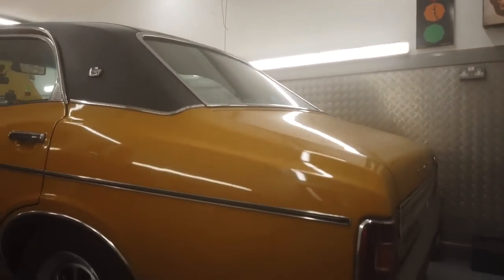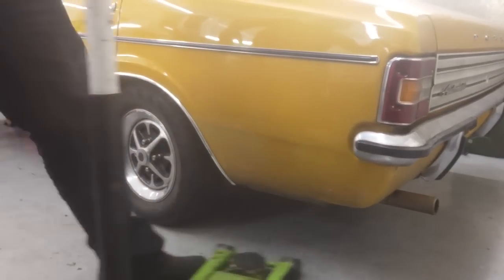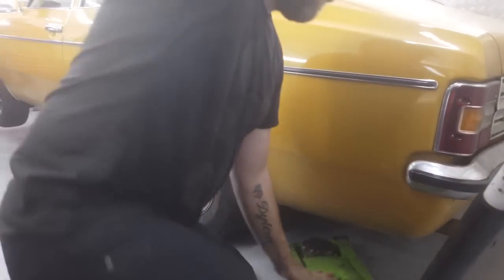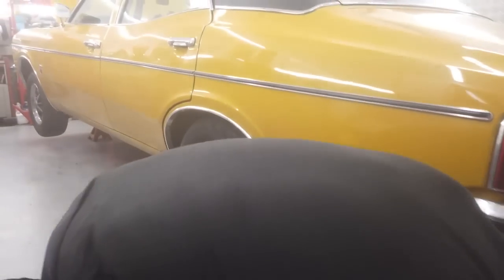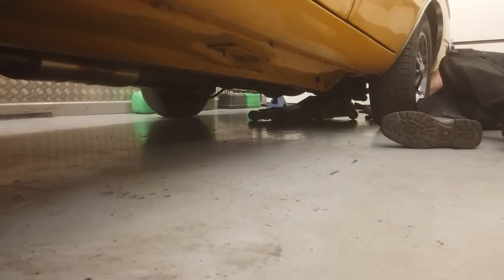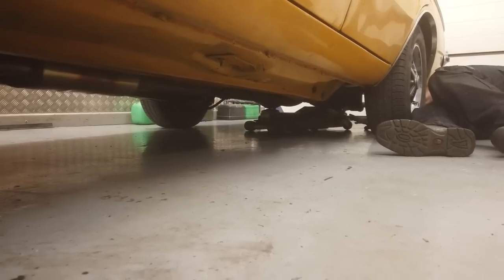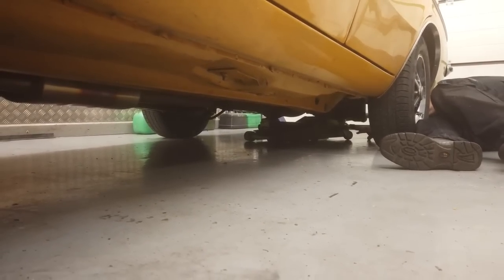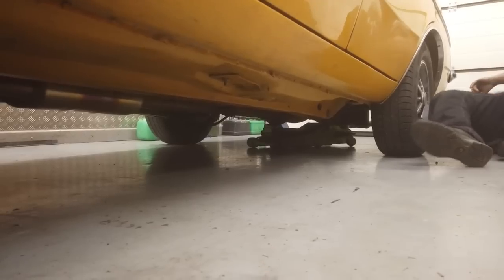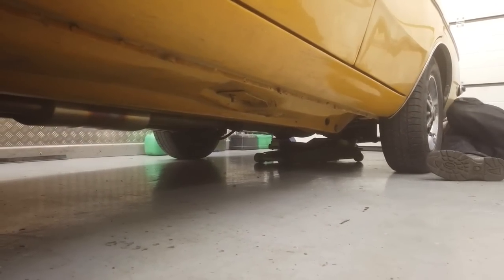I've got to try and just crawl under the car and get those important laden weight readings, because even though you try and simulate the laden weight with the jack, you never get the same reading as if you're on the tyres and wheels. So I want to finalise the prop. I've got a feeling I need to go about 1 degree nose up on the prop just to give me that tolerance, although it didn't vibrate at speed. So we actually were okay, but this is just to satisfy curiosity and also to explain to you exactly what I mean about pinion angles. I'll wipe the whiteboard clean, and I'll try and show you again.